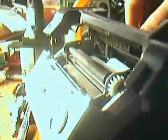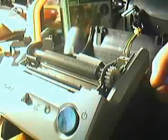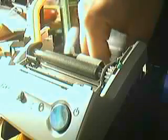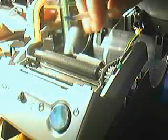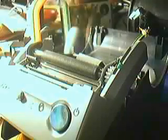Now, what you've got to do is, inside here where the sensor is, there's a small cable. It's a ribbon cable with 4 conductors. Anyways, it sits up in here. You've got to get that out of there and set this off to the side. I've already got mine out. I'll go ahead and unplug this sensor from the board, which you'll probably end up doing. It's a small one. Just make sure you remember the orientation and plug it back in when you put it all together.